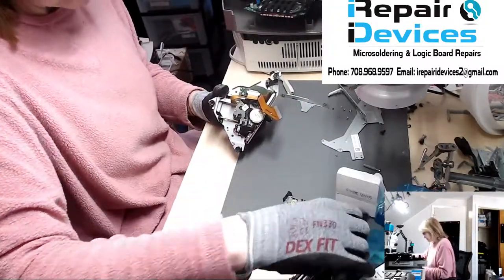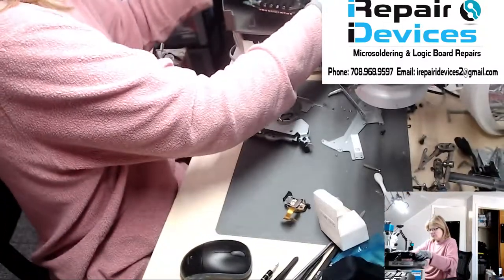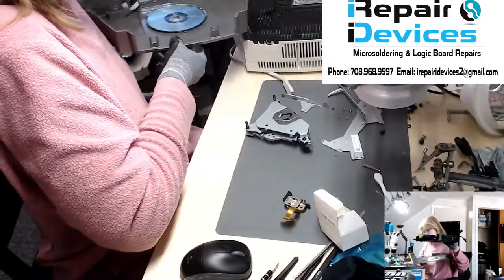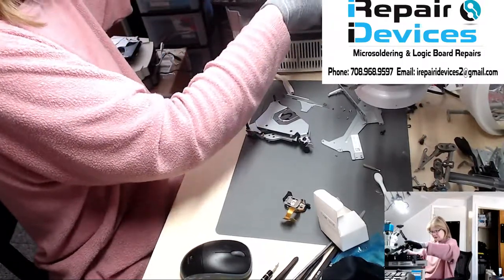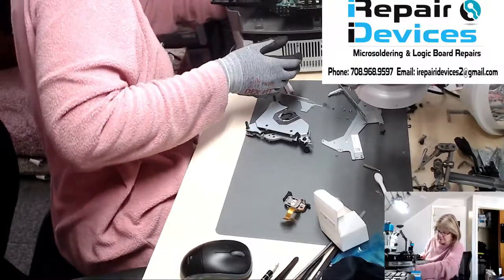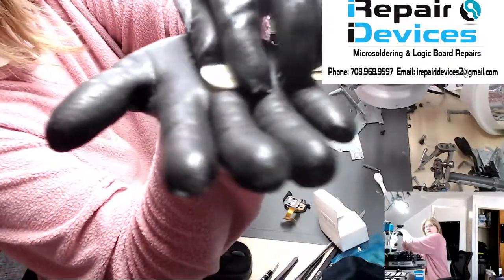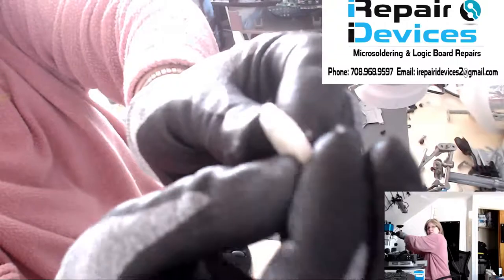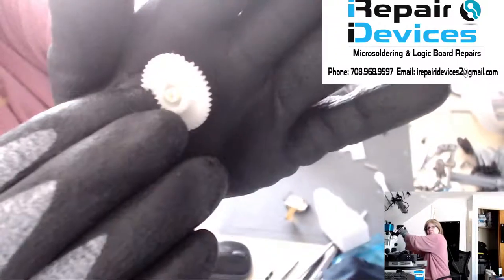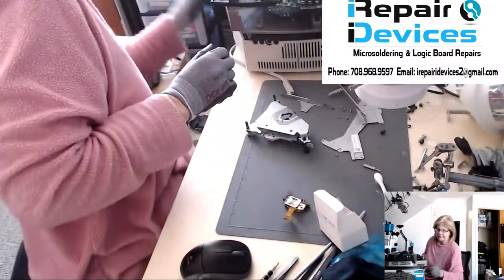What did I do with it? The initial problem was the gear. There was a broken gear. And here it is. One of the teeth was broken on here. Let's turn this guy off. All right, let's get this guy to focus. There he goes. Let's angle it. You see one of the teeth is broken off, and that was causing the stuttering on the drive mechanism itself,